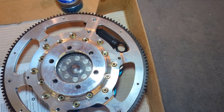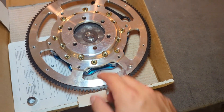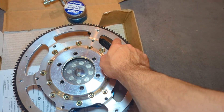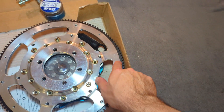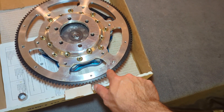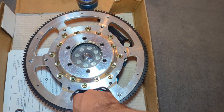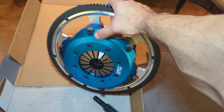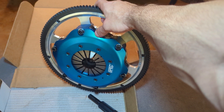The phenomenal thing about this setup for my rotary application is this is actually a custom flywheel, which is made from forged aluminum. David Norton at Speck, who's the owner, I talked with him and he recommended this for my car. I was looking for something that would rev really fast, but would also be able to take the heat of me slipping it on the street. You'll notice that a lot of race cars like the Mazda 787B will have a smaller clutch design — they'll be using a 5.5 inch or a 4.5 inch.